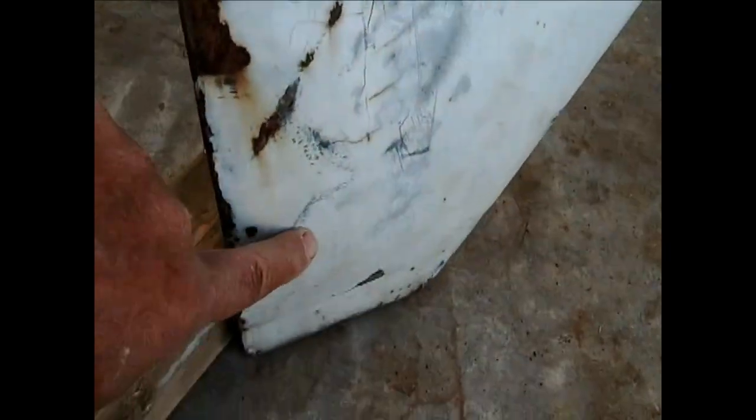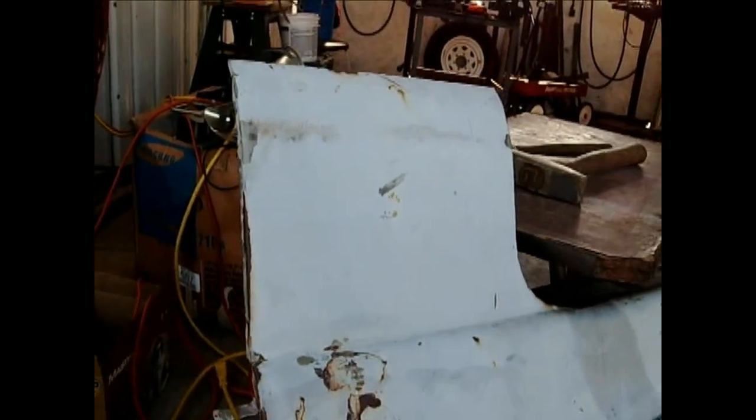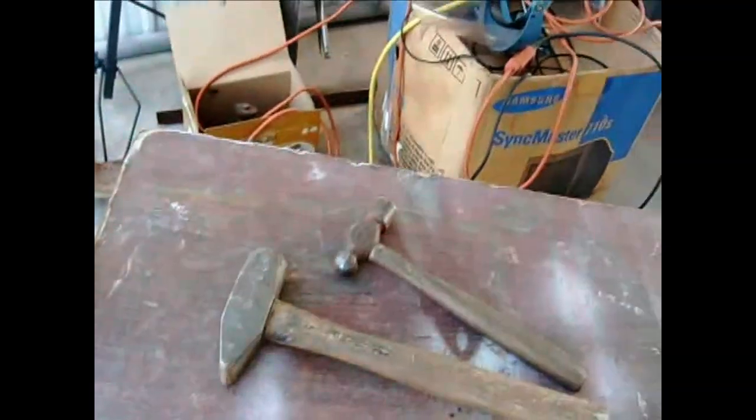The front side of the replacement fender was really true to its shape — no dents. The backside had been pushed back a bit, but I removed the brace on the inside and now it's really straight. That right there was undamaged.